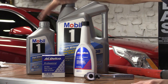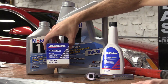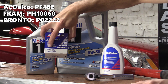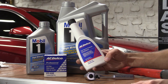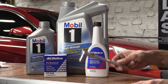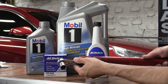Let's start with what we need for the job. This car takes six quarts of full synthetic oil, the 5W30. I'm using the Mobil 1 high mileage. You're also going to need an oil filter — I've been using AC Delco filters. I'll put links in the description to various ones I've used, but today we'll be using the PF48E. This is all stuff readily available at Walmart. You'll also need a 15 millimeter socket, and usually I like to have something to use as a breaker bar because that oil bolt gets quite tight.